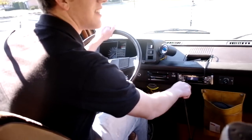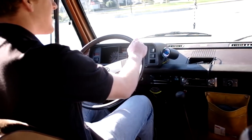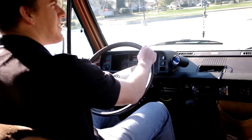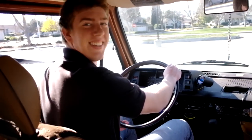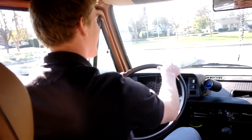Oh, feel it. Is that first? And then you slowly let the clutch out and put the gas on a little bit. Little gas. Okay, and then just slowly, oh, you're moving now. Okay. And you're engaged. See, that's all you gotta do. You just gotta engage that clutch a little bit.